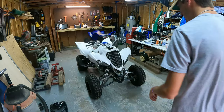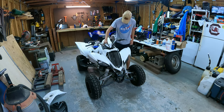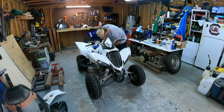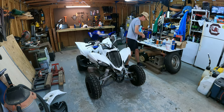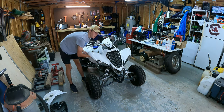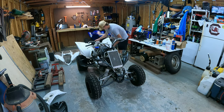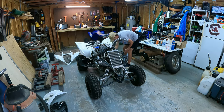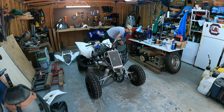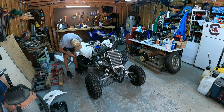The first part I took off was the black radiator cover or grill - it's only two Phillips head screws at the top, pull it back and pop it off, it's just got some clips on the bottom. Next piece was the gas tank cover - two clips on the back and two bolts on the front, undo those and pop it off. Next is the front plastics - there are eight to ten bolts, unscrew all those and just pull it off. There's nothing really holding it on other than the reverse cable.